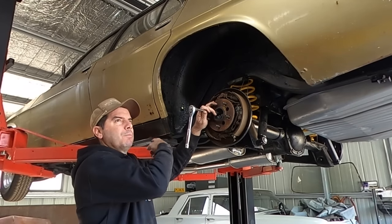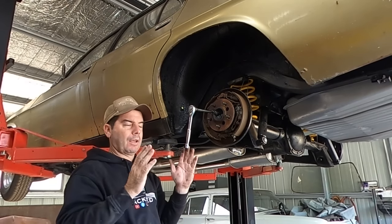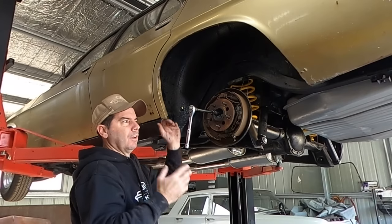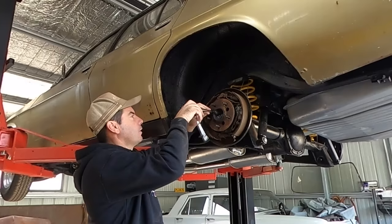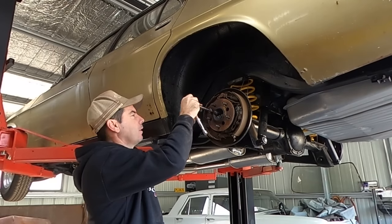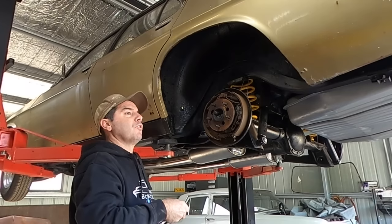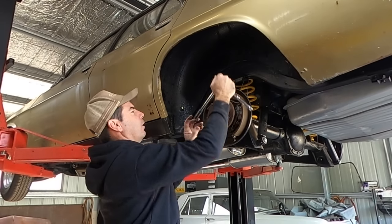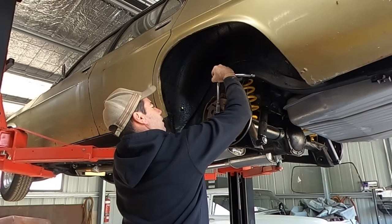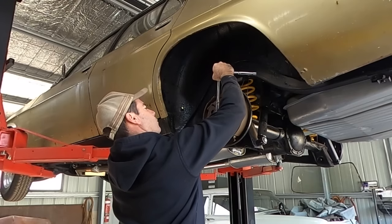And also the big block can sit slightly further back because of the length from the mount to the back. So the Turbo 400 could be a little bit further back, which I did have to modify that cross member, so probably the case. And yeah, I just turned a 253 Trimatic cross member around. I'm just tapping it on the drum to get that nut to fall out. I reckon 7,000 or 8,000 more taps and it'll come out.